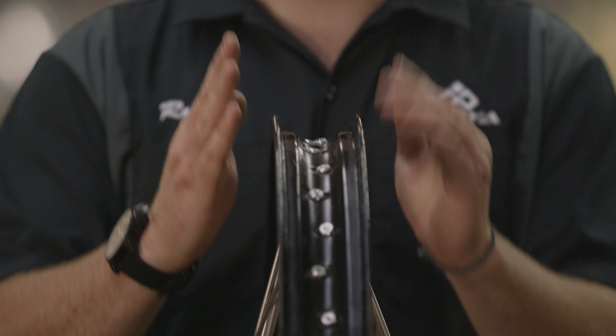Hello, my name is Robbie Luce with W. We're going to be going over general wheel maintenance today. First thing you want to start by doing is once you get your wheel, whether it be on the bike or if you're taking it off, go ahead and give it a visual inspection. Make sure there's no flat spots going around the outside of the rim, or major dings where the rim is spread apart on one side or the other, and make sure there's no broken spokes. If you have any of that stuff, you want to replace it right away. We'd recommend if you have a big major flat spot or took a big hit to the wheel, taking it to a professional, having it retrued or checked, or if need be, have that rim replaced.